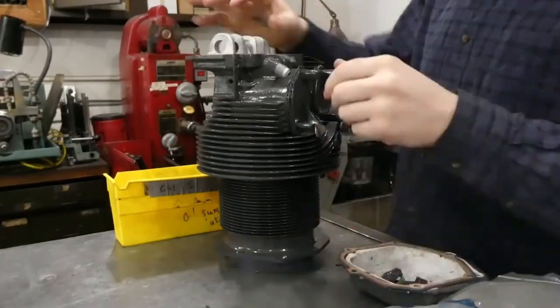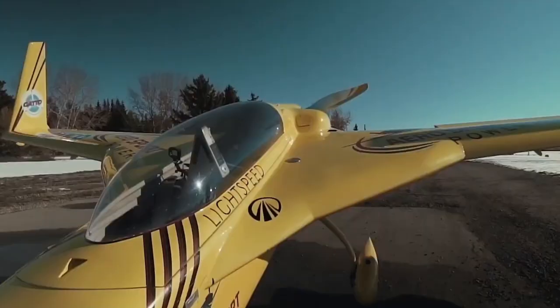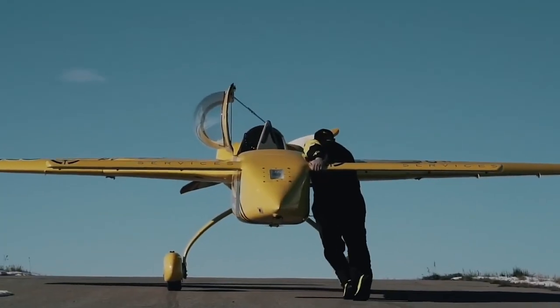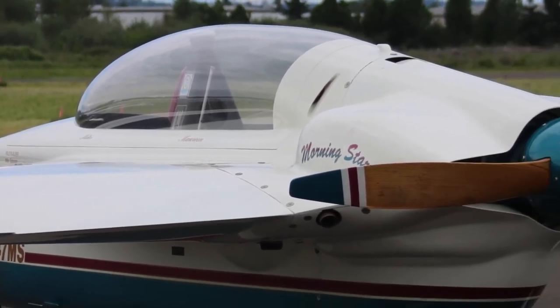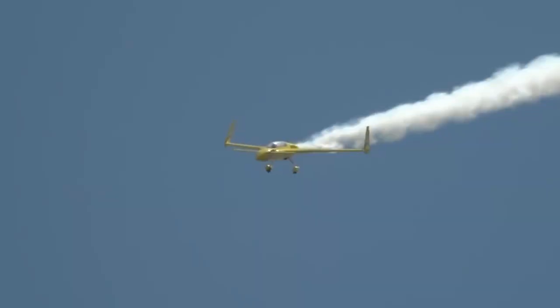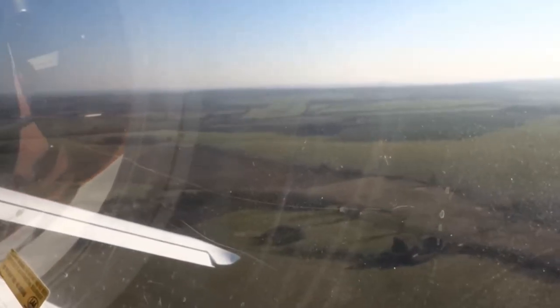Designed around a Lycoming O-235 engine, the Long-EZ not only had a longer, sleeker fuselage, but a larger main wing with a less sweep angle. The wing root strakes were bigger, giving more space for fuel and baggage, and the cockpit was wider. With 52 gallons of fuel, the Long-EZ could stay aloft for as much as 10 hours.